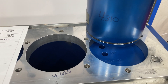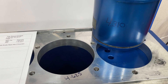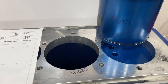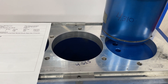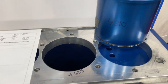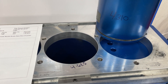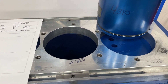Now, if you watched my previous video, you would have seen me talking about the Brodix RaceRite 270 head that I had ported and flowed. I was just playing around and wanted to see what it would do here. Of all the heads I've done, it's probably the least shrouded one because it's just got a 2.25 intake valve and a 1.88 exhaust valve. It's actually kind of made more for the 4.310 bore, but out of curiosity I wanted to see what it would do on the bigger bore.